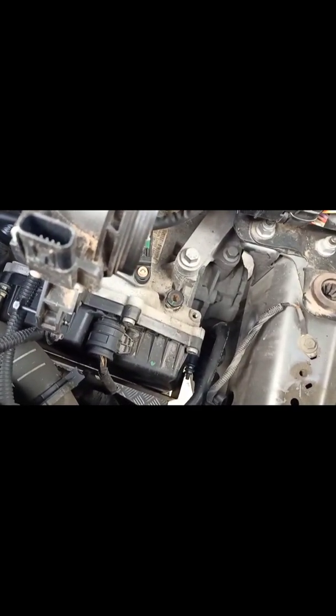Now we need to undo the plug for the level. On the left hand side near the front drive shaft, you can see there's another bolt with an Allen key head. That's your level plug, so we're going to take that one out as well. Make sure that you put some sort of pan when you're removing the filler plug and also the level plug, so you can catch any excess oil dropping. As you can see, once I remove the plug, the oil will drain. So I already have my pan ready to catch excess oil coming out from here.